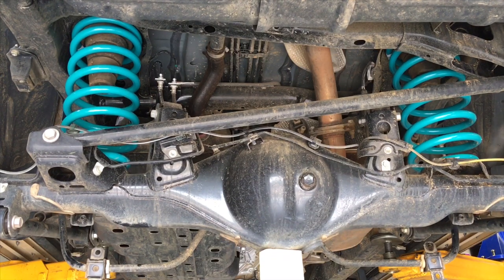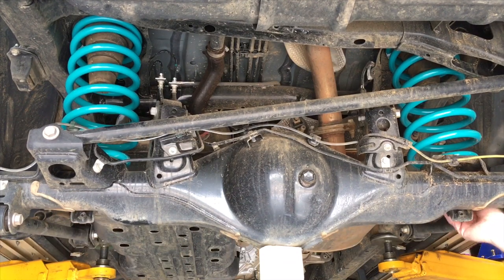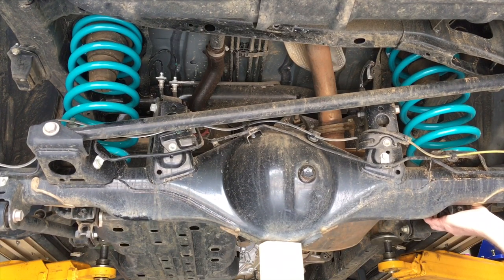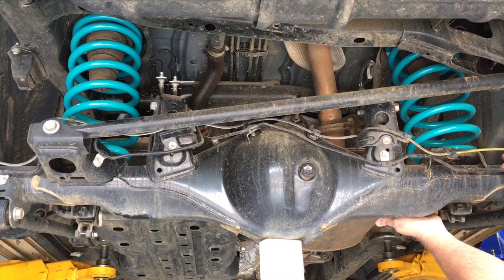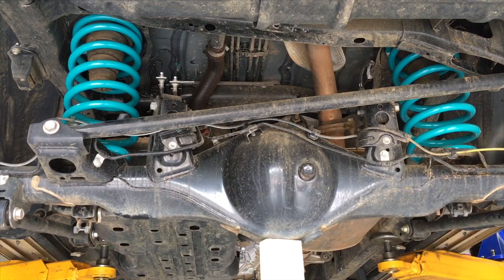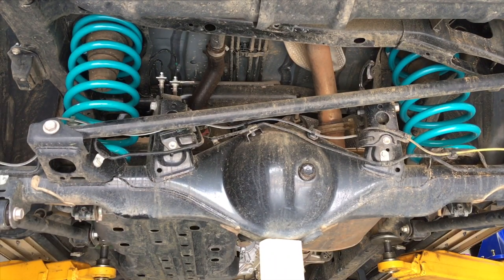So this is, okay, you've got to watch this sway bar, remember what I said? These are heavy springs, so if I don't get these pretty soon to where I want them, we're going to give it up and just jack one side at a time, because we don't want the car lifting off the horse. It can be very dangerous, but as you can see, we put a bit of muscle into it, we've hooked one on, that means the sway bar is going to stay where we want it to. That's all I was doing, okay? I'm not even going to bolt it up. Just want to get the sway bar up, hooked on where it needs to be.